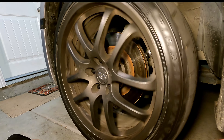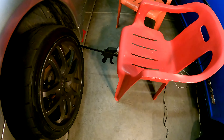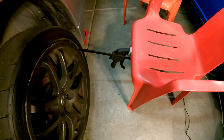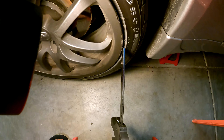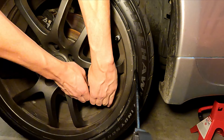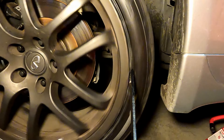This wheel sounds good. The rotor is not making any weird noises, the bearing is moving smoothly, and there's no wobble. While we're working on this wheel, we can also check the rim to make sure the outside part doesn't have any dents or an oblong shape causing rumbling. I've put a clamp onto a chair — if the rim is not a perfect circle, we'll see a change in the distance between the wheel and the clamp. Spinning it now, there are no large dents or anything noticeable. This wheel looks good.